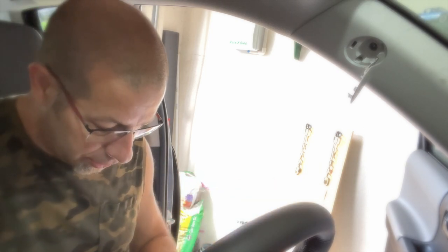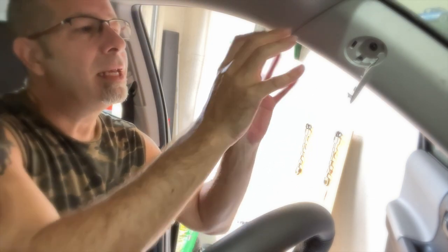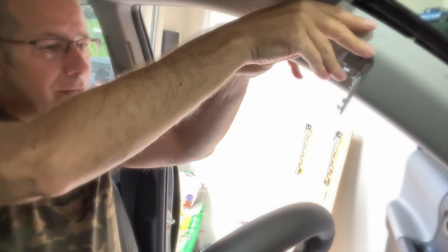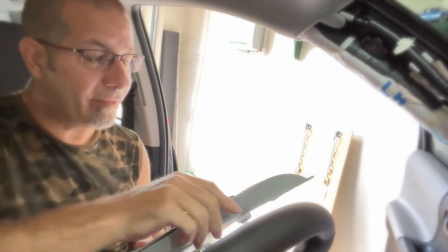That sleeve-like thing is just to hold it in the plastic hole. Once you have that out, we should be able to pull the trim piece. One thing I always do — there is some weather stripping along the outside of the door, so I just run something down the edge of it between it and the cover to make sure it's nice and free, not stuck or anything. Why make it more difficult than it needs to be? Now you should be able to just grab this piece, pull it out from the top, and then at an angle pull it out of where it's held in. And there you go. You can see these are the little prongs that hold it in down in the front. We have it out — it's just that simple.